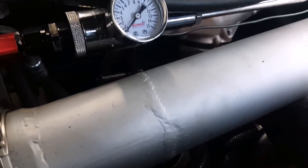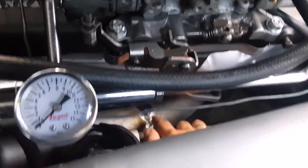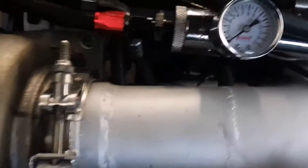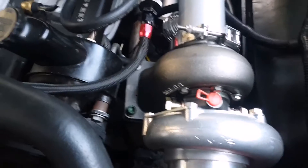There's a brand new donut gasket in there, hoping that's able to seal it up. From the previous video you can see there's been a new weld — we had to tweak the alignment a little bit. It goes right up into the square T4 flange just below the turbo, and that's all mounted up. Overall very sturdy; I cannot seem to move it, which is great.